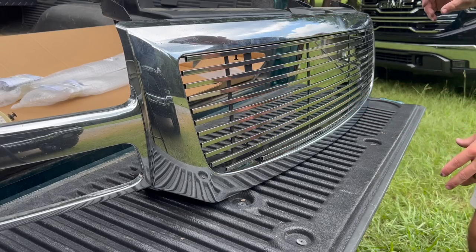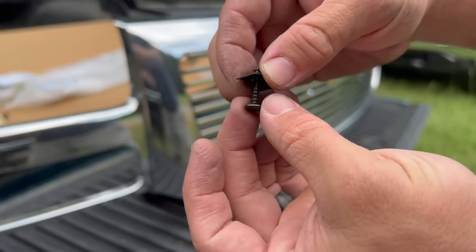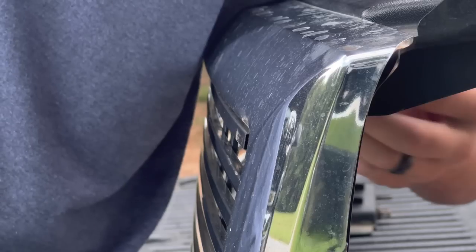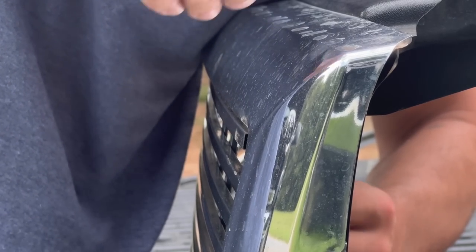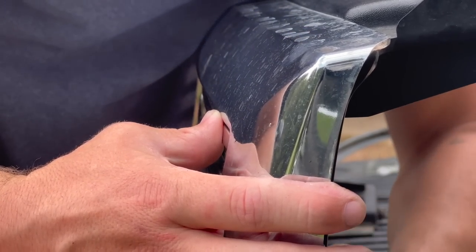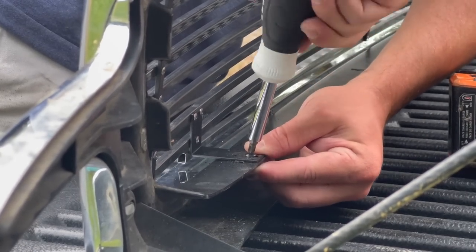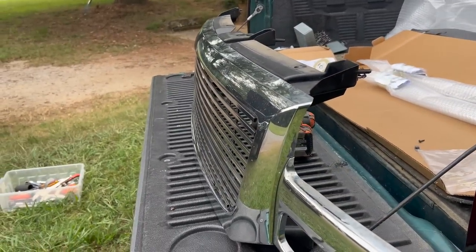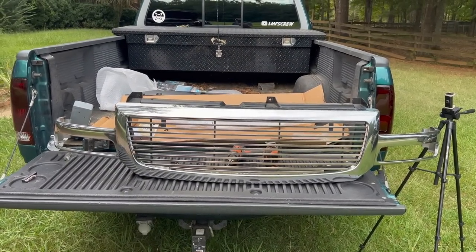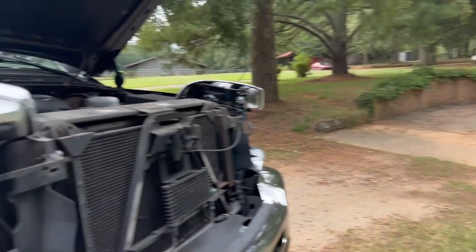Let's see exactly where we want it to be, as flush as possible. You're just going to screw through, and this is just going to allow it to tighten on the backside. You all see how there's a little bit of play here - take your little guy, put it on top, and then screw your screw into it like I'm doing now. It will start to bite, and then just take your finger and push it in to where it's perfectly flush, like this. And then just tighten it down. All right, here she is - looking extremely good in my opinion. Obviously we're going to have all this black behind it once we install it, so you're not going to see straight through it. I think that came out pretty much perfect. Some of these bar grill inserts are wavy or they don't fit good - so far it's fitting A1. Let's go ahead and throw it back in the truck and see what it looks like.